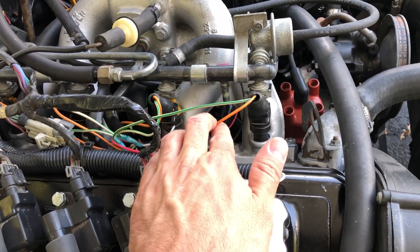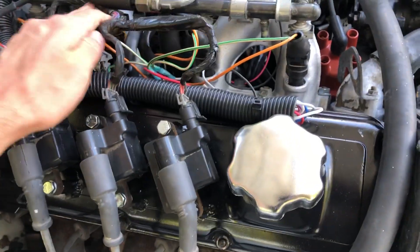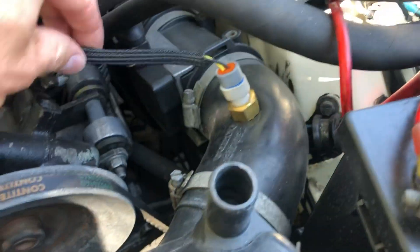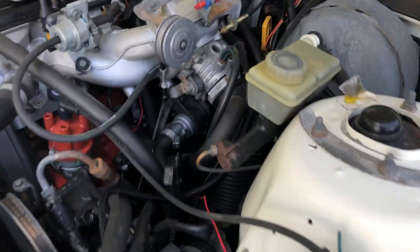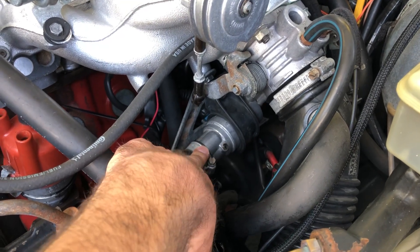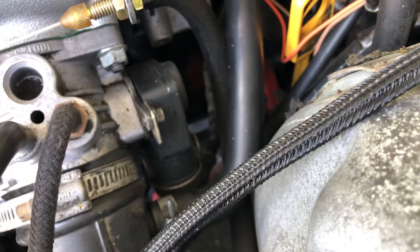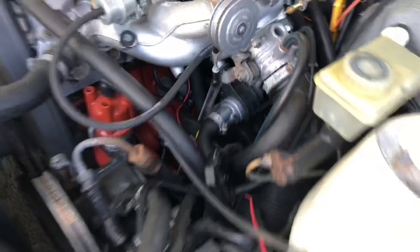I left the factory wiring so it gets power without needing a separate fuse panel, and it just grounds by the ECU. I ran a generic GM-style intake air temperature sensor and just popped a hole in the plastic and stuck it in — works fine. I'm using the factory Volvo idle air valve, still run by the factory ECU. I also installed a potentiometer-style throttle position sensor from a BMW E34 535i automatic.